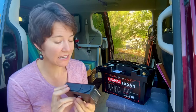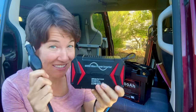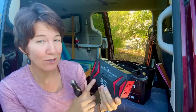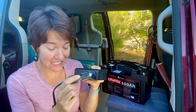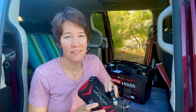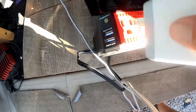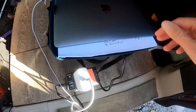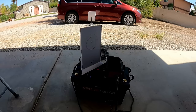So if you wanted to plug in a regular wall AC plug, you don't have that. But I'm going to show you a workaround. You can buy an inverter that plugs in with a cigarette lighter plug. This is a 300 watt inverter, and it can plug into the DC port. And now, voila, you can run your AC items. I bought this for $57 off Amazon, and I was able to charge my MacBook computer, which takes about 40 watts. I also plugged in my Starlink internet, which takes about 40 watts, and it powered that just fine.